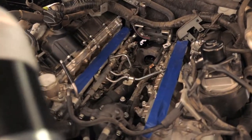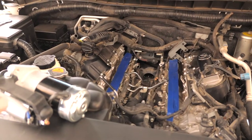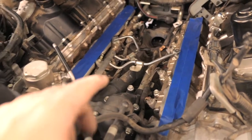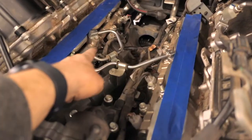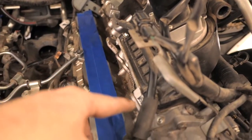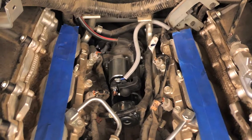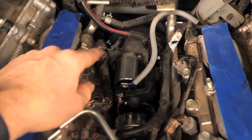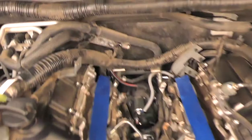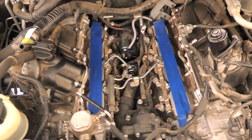All we have to do now is work in reverse order. The starter goes back down in there — the area is clean and fine. Be careful of the fuel lines everywhere since this is direct injection with high pressure, including a plastic fuel line tube right in the way. The new starter is in: both bolts tightened, the main power wire connected, and the switch connected back to its bracket. Next step is putting the whole intake back on — don't forget the plug in the back — and then connecting all the hoses.